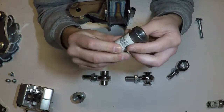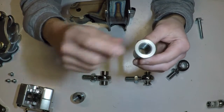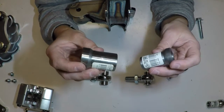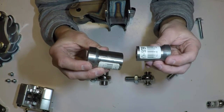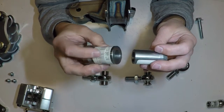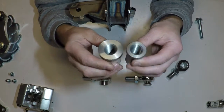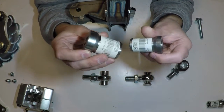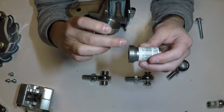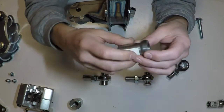These bungs can come in a couple of different sizes. This one here is a three-quarter inch thread, and this one here is also a three-quarter inch thread — these are round bungs. This one is made for an inch and a quarter tube, this one here is made for an inch and a half. You can also get bungs in square, and you can get them with bolts to tighten them down rather than jam nuts.